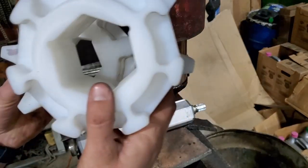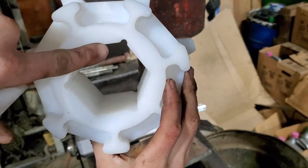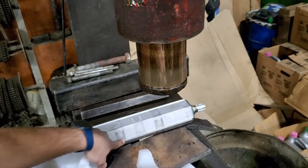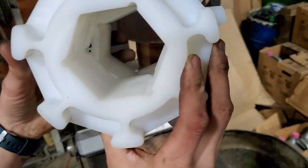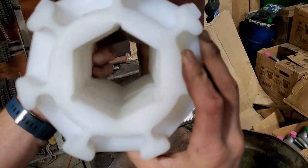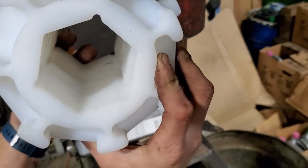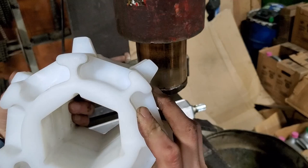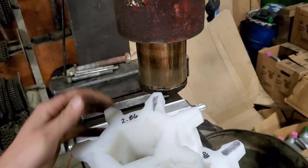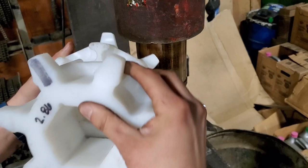Here's an important thing to keep in mind. The shaft has six sides and there are seven cogs on the outside. You can see there are little dimple features that match up with pieces that stick out on the shaft — some stick out, some don't. As you're putting this on, make sure you line those up. You can see when my center is lined up my outside is also lined up, but if I rotate it the center lines up while the outside does not. Both cogs do go opposite of each other, so one is on the outside on one side and the other is on the outside on the other side.